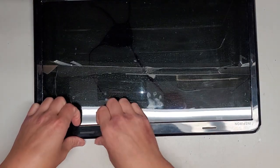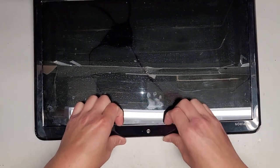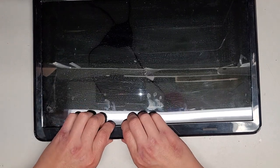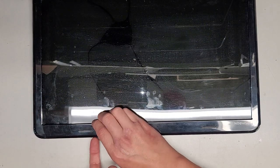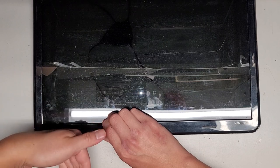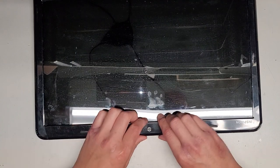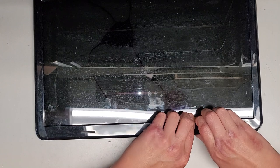Let's go ahead and remove the screen. I'm gonna rotate it upside down because it's probably easier. This one you can't just pull up like this — on a lot of them you can, but in this case because there's clips that go into the top, you have to pull it back this way and kind of pry this side up a little bit. So I'm pushing with my thumb on the back half and pulling with my fingers this way to get it up. There you go — you can hear it click. You have to rotate it this way to unclip it, and then pull up that way.